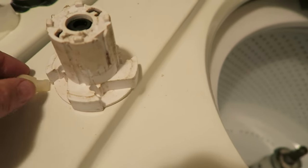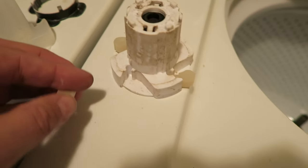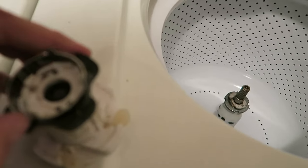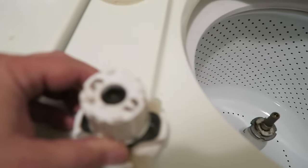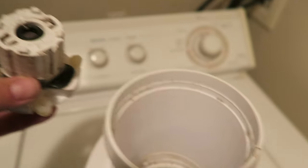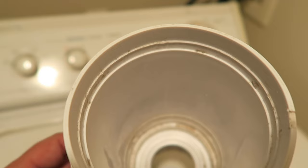You've got to place all four in there — you can't just flip them upside down, that will not work. You'll notice that these little inside grooves fit into the grooves on top, and it just slides down. All reassembled. So we're basically going to take this and put it back in. Make sure that your agitator dogs are on the same side as where the teeth are, otherwise it's going to do nothing.